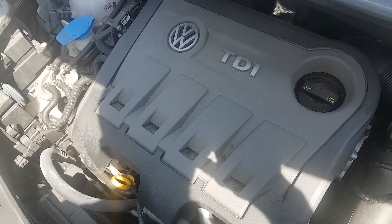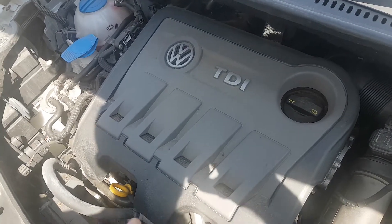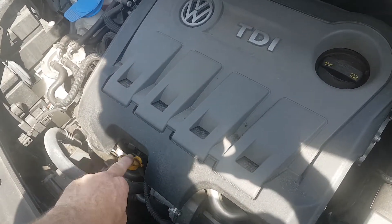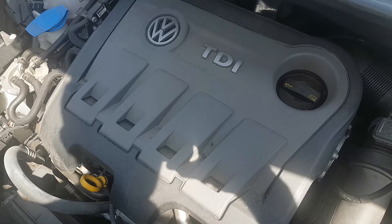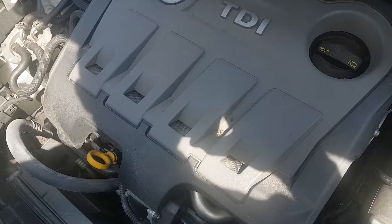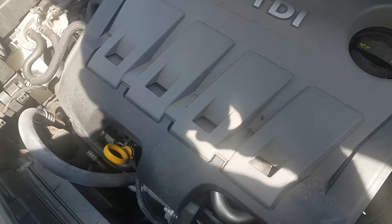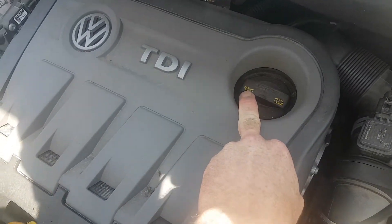That's your engine there in front of us — a Volkswagen turbo diesel injection, TDI. To check the engine oil, you pull out the dipstick there. This is generally done when the engine is cold and the car is on level ground. Pull out the yellow dipstick — it's a long kind of a wiry thing. Pull it out all the way, give it a good wipe or clean with a cloth. Put it back in, and the second time you take it out you check the level of oil at the bottom of the dipstick. There are two indicator levels clearly marked at the bottom, and that'll show you where your level of oil is. If you're short a drop of oil, put some in here — that's the oil can symbol, that's where you put the oil in.